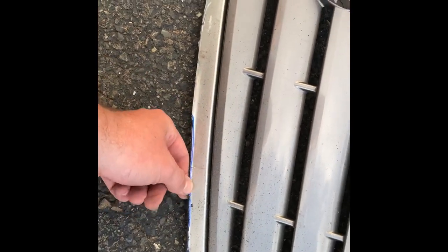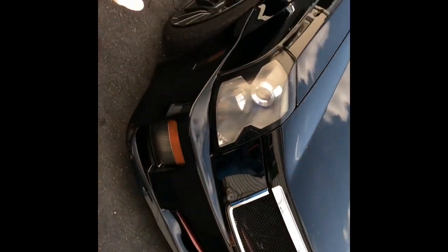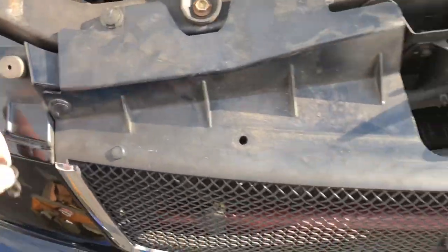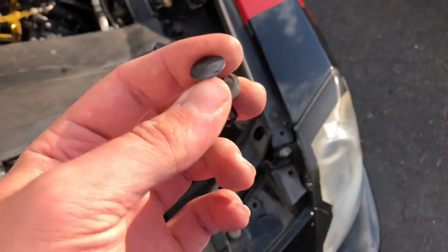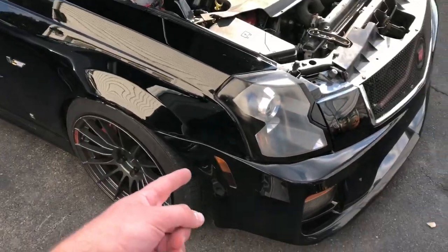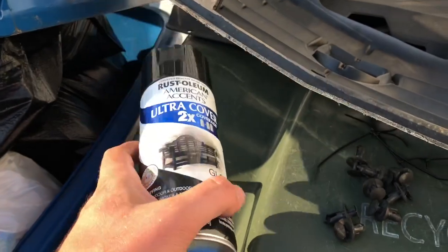Here we have the grill piece cut and trimmed up. There are just a couple spots I'm gonna clean up, but I think it's time to pull the bumper off and see where we size up. First step — pop that piece off, and then there are all these pins holding that piece on. You want to pop the middle section out first and then the whole thing will lift out — the middle piece is like a lock. We're gonna need to reuse those that are holding the outside of the bumper on, and the whole thing will just slide right off.